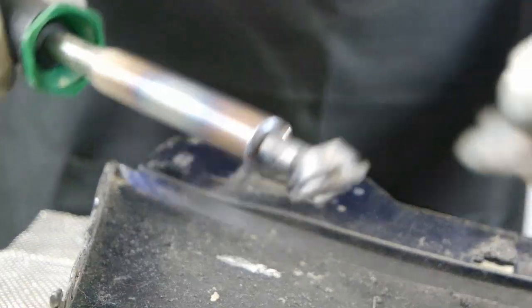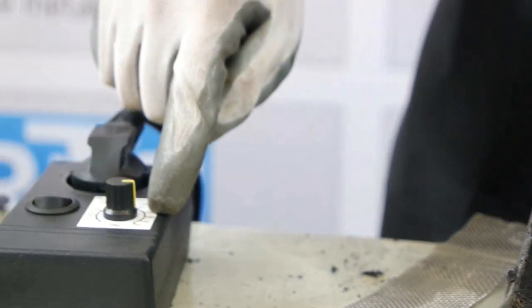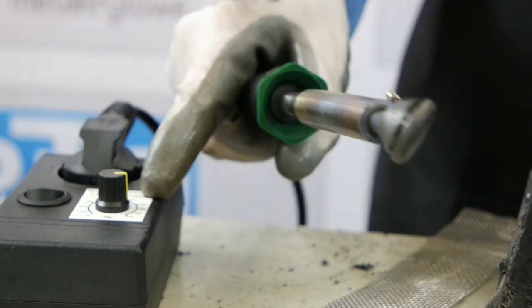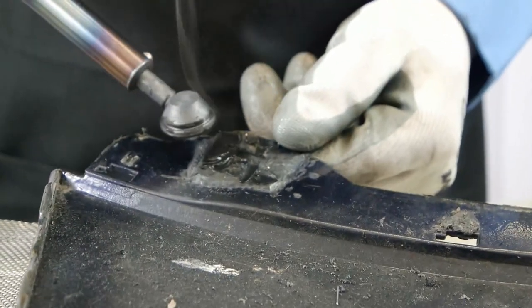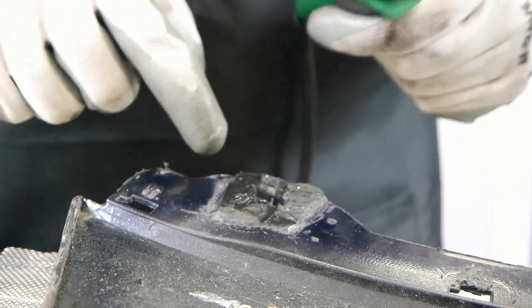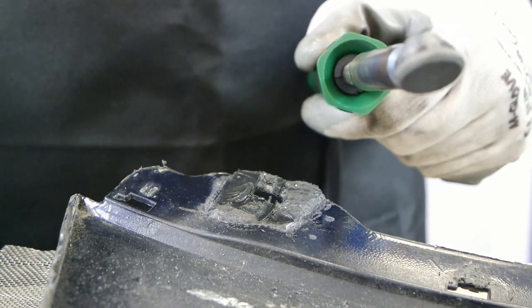The iron is hot. It is important to use the appropriate power level. Here I am using about 60% of power, as it is perfect for PP. Remember to preheat it a bit to set the desired temperature. So set it, say, 60% at first, and then test how it works. Wait 3 to 5 minutes until everything heats up. Test if the material melts a bit, make sure it does not melt completely. And if everything's fine, only then you may adjust it, if needed, to 10 to 20% more. Here I have increased to 80, but 70 is fine.